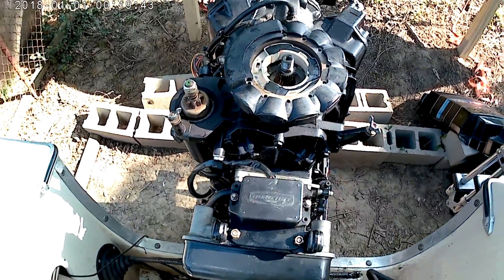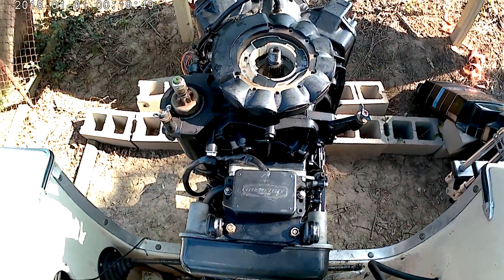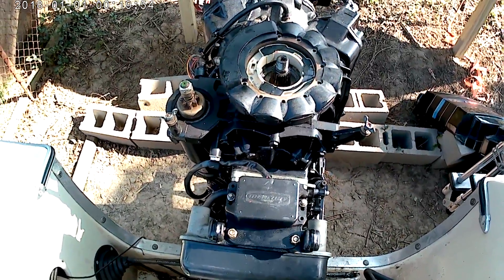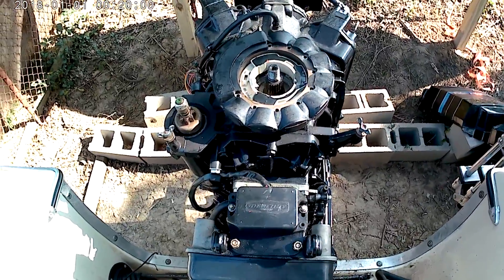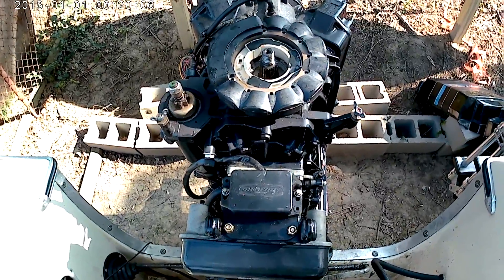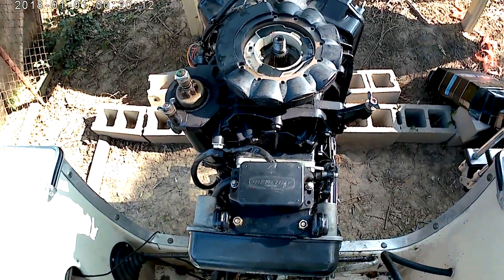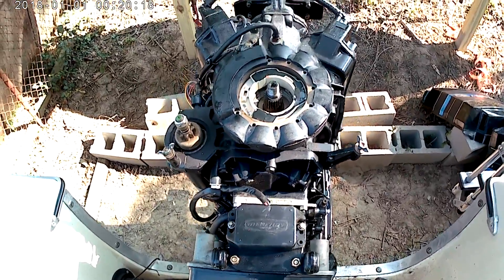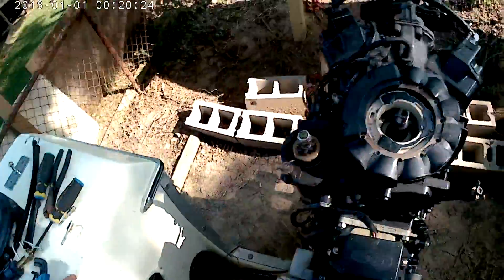What was happening was at full throttle — when I launched the boat it was fine, kind of hesitating. I went out boating for the day, swam and fished a little, and coming back in I had no power. It just bogged down — I was at full throttle pushing maybe 2,000 RPMs and the water back here was just churning like crazy but I was going nowhere. I did make it back to the dock.